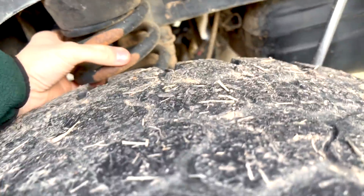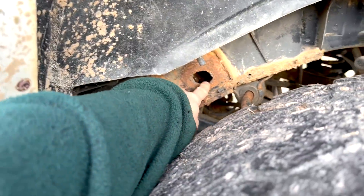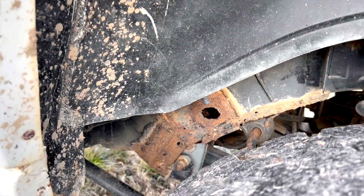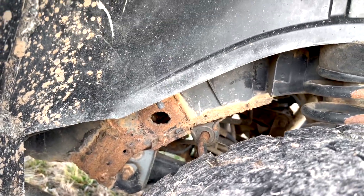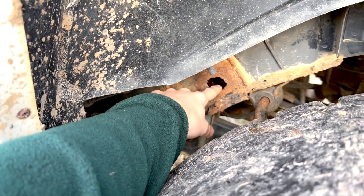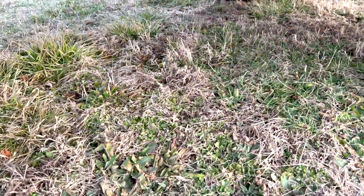I don't know where to start. You got this coil that looks interesting, but obviously there's this big hole. Unfortunately they decided to weld on a bunch of supporting metal to do their own lift kit. So they bought some arms and then just welded on pieces of metal to hold it. This is the biggest hole in the unibody, so that's going to have to be fixed — I'm sure there's rust around it. But that's the only spot I've seen a hole in the unibody.